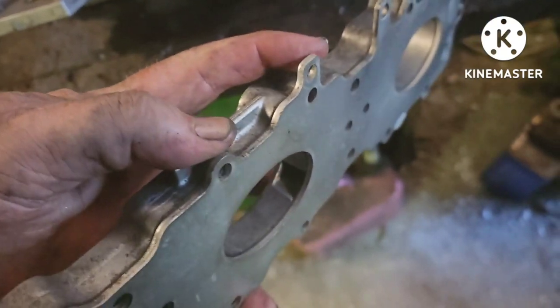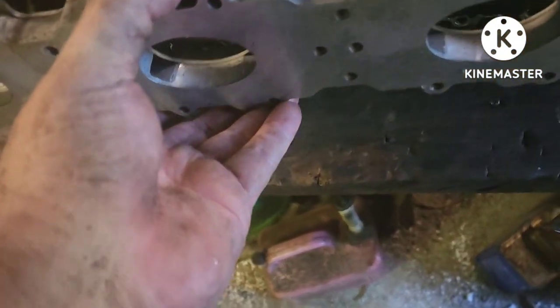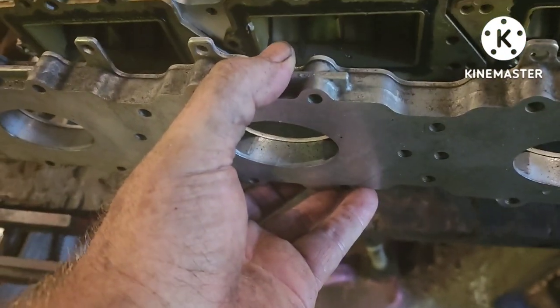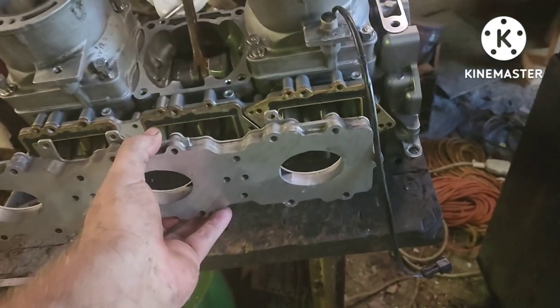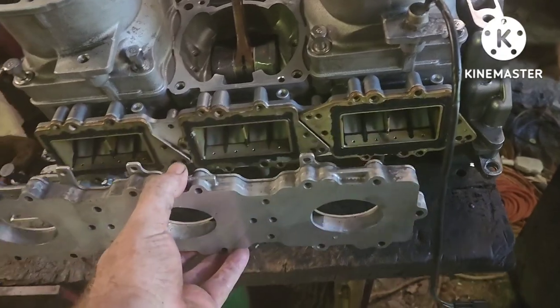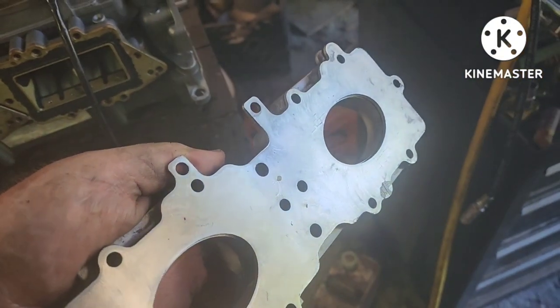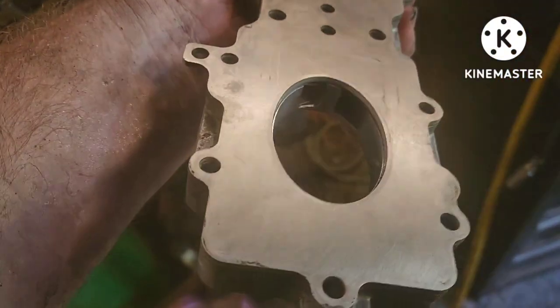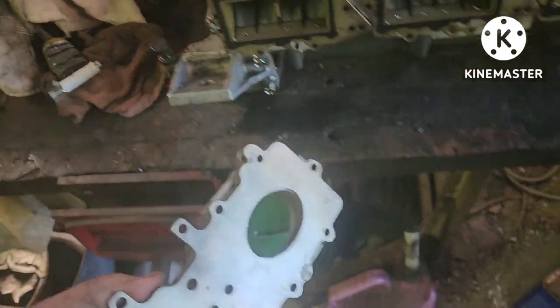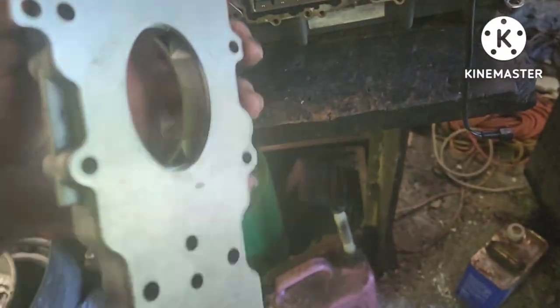All the other ones I've done — see, this is actually two plates. This thin plate goes first behind the reeds like that, and then it bolts on. I'm going to look at my video of when I took it apart, which is another good reason to video your work. I want to make sure this is the way it goes because I don't want to put it on backwards. You can kind of look at the markings before you wire-wheel-brush it, but I've got video and I'm going to refer to it to make sure I don't put this plate on backwards.